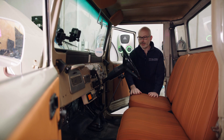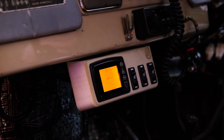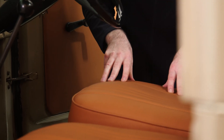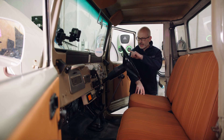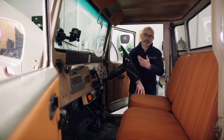The seats are in permanently with heated seats, and switches on the custom dashboard. On the Prado we've got three switches for the heated seats, and the smart gauge for the motor which shows the battery state of charge, the speedo, and how many kilometres the motor has done. We've also relocated the enormous 12-volt battery from the front to under the driver's seat — that's an Invicta battery from Jack's Tyres. The dashboard has been repurposed: the fuel gauge is now the electron gauge showing how much range you've got left, and the temperature gauge shows the temperature of the controller. It's all useful information.